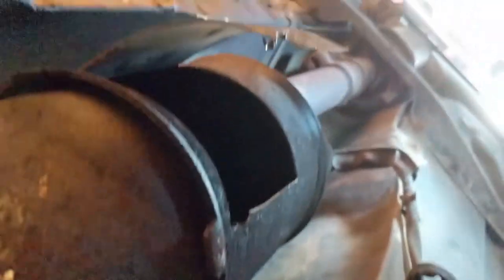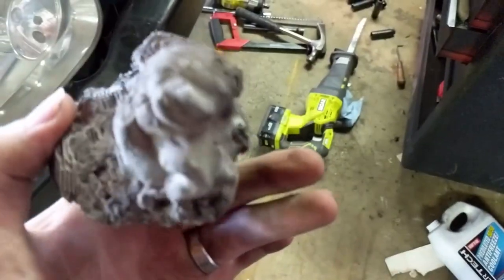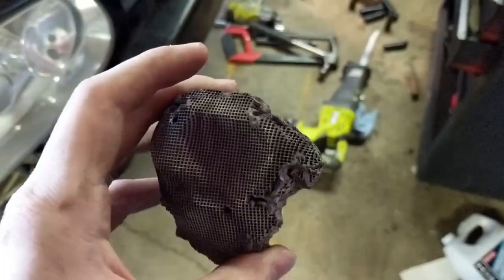So I cut up the inside. Let me show you this real quick. I cut a hole in this because I didn't feel like cutting the whole thing out and I can easily weld that back up together. Let me show you what fell out. So this is what the honeycomb is supposed to look like — not so much that. Basically the entire catalytic converter is filled with pieces of this garbage, and yeah, that's definitely what was rattling around in there and making it sound really bad.